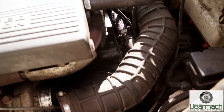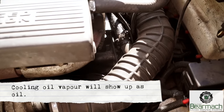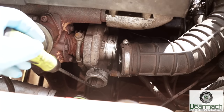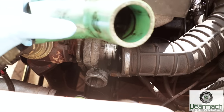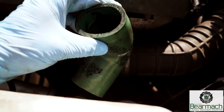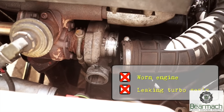You have a breather which goes into the inlet pipe — this induction pipe — and naturally this will have oil in it because oil vapour will condense in the pipe. However, we've cleaned this out and noticed that through the turbo, this is after the turbo on the compressed air side, we're looking at the pipe here which hasn't been on that long and it's incredibly oily. It shouldn't have this amount of oil in it. The presence of oil could indicate either a breathy engine or the fact that the turbo seals are leaking.